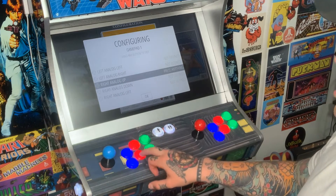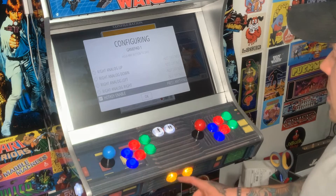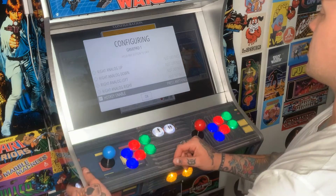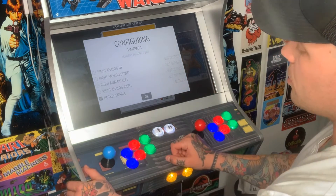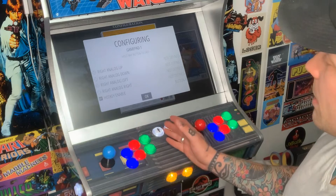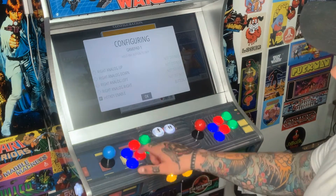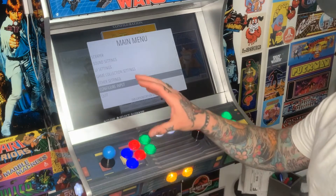The hotkey option at the bottom is the button you press to exit ROMs. I'm going to assign it to the select button, which is pretty standard. That means if I'm in a game and want to exit back to my game collection menu, I just hit select and start at the same time — that enables the hotkey and automatically exits from that ROM. To confirm, just hit the A button; it'll load for a second and once we're back at the main menu, player one is all set.